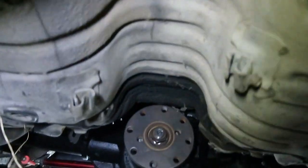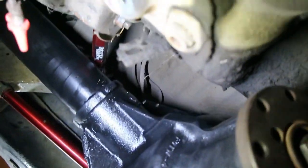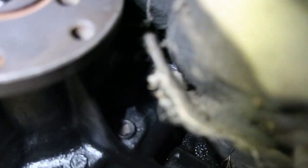We've got the pinion, as you can see, pretty much perfectly centered — that's with the entire axle centered up. The spot I said would hit right here has been cut, and you can see it clears pretty well. There's really not much that can hit on it. It's a little close right there, but I think it'll be all right, and then up to that spot there.